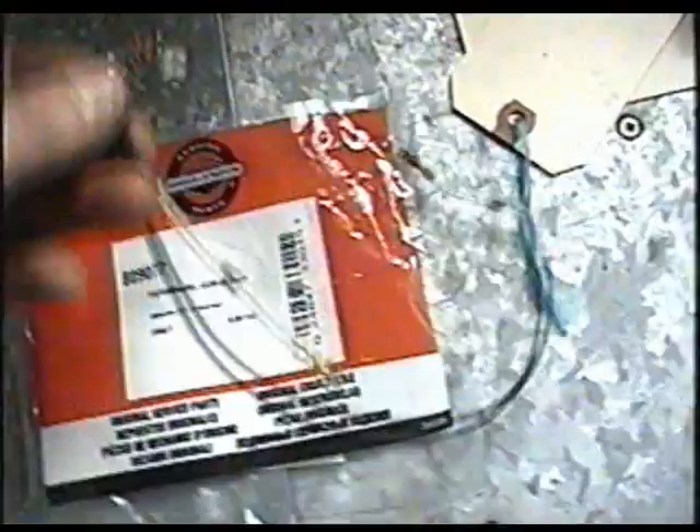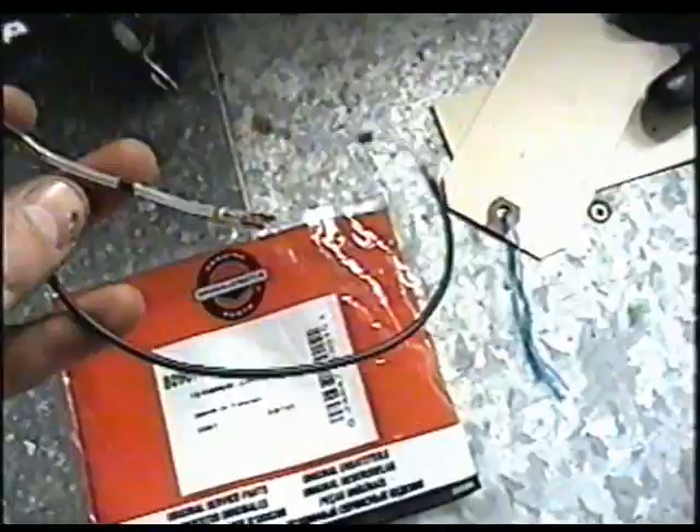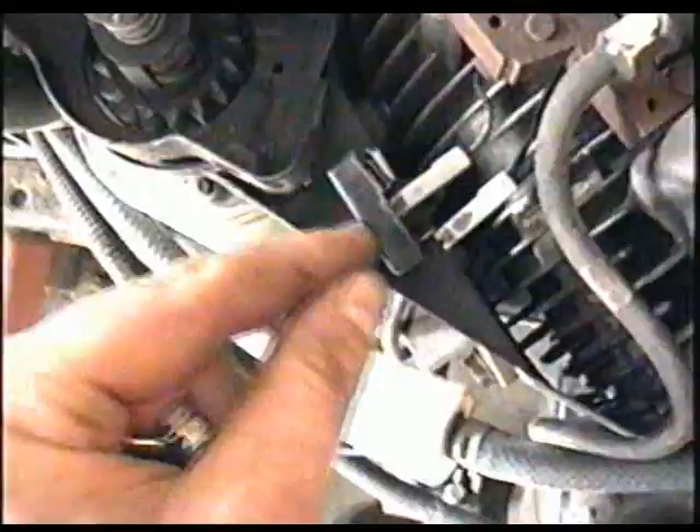Now here's the part for that. It's number 809077 from Briggs, and the part is slightly superseded because they put the diodes in the wire itself. So you can see on the engine that there's no diodes in the wires — it's all in the one little box here. So I'm going to have to take that off and then attach this new one on.